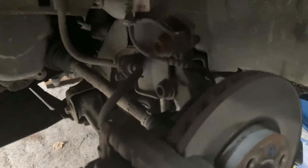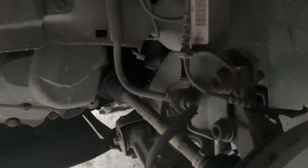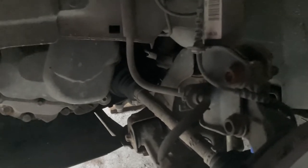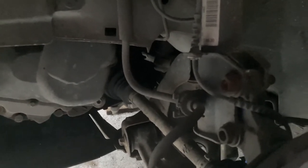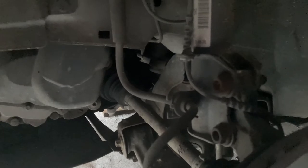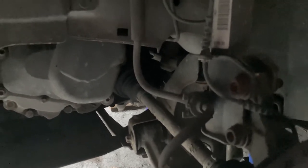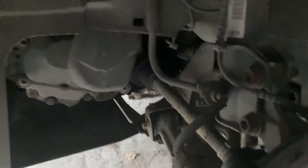A quick mention: I keep saying F17. With Opel gearboxes — at least the petrol ones — there are multiple variations: F13, F15, F17, and so on. The number after 'F' multiplied by 10 gives the maximum torque the gearbox can withstand in Newton meters. So F17 can take up to 170 Nm. If you want to make any engine improvements, check the rating of your gearbox and make sure you don't exceed the torque limit.